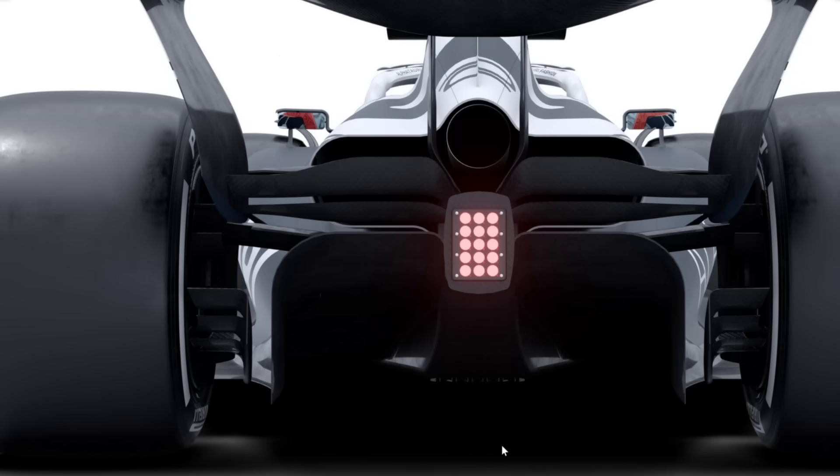At the rear there's a wider letterbox inlet which is probably going to vent a little bit above the beam wing, coming through somewhere in the middle of the wing box. The bottom of the beam wing inlet and the edges of the diffuser would be receiving a comparatively clean flow drawn down from the top of the side pod. Very similar intent in terms of getting clean air to the beam wing and diffuser top surface, but an incredibly different strategy, and it'll be very interesting to see how this plays out.